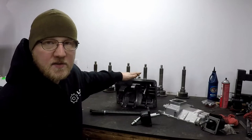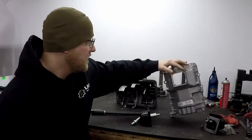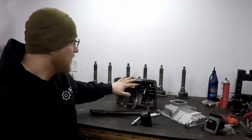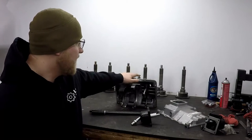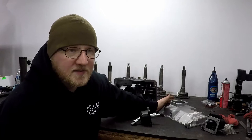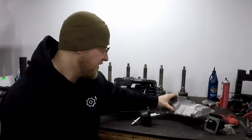You can actually convert these and we do it all the time. We get these square top shifters — you can get them anywhere: Transtar, Torquing, TPD, all those places. You can move all the guts over; you have to buy a few new parts like the reverse shift rail and a small parts kit. You can move all the guts over so you don't have to spend what I think was six or eight hundred bucks for a loaded square top cover. This one is $140 on the internet.